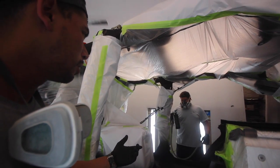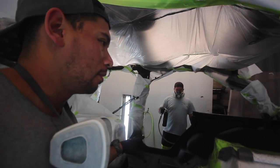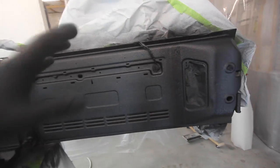We definitely tried building up the areas right where your feet go. So far that's only three liters — we probably got two to three coats over the whole thing, but right here over the tunnel where your feet go we put probably like five coats of thickness, and even up in here we put like five coats because that's where your foot's going to sit all the time and it could wear out. He put a lot back here too because he's not putting any carpet back — this is going to be like a truck bed almost. He's going to have a cooler and all his stuff can beat up against it.